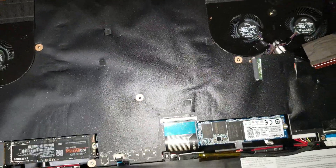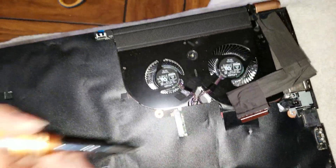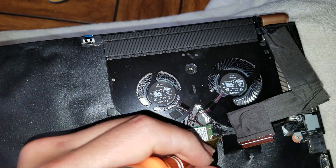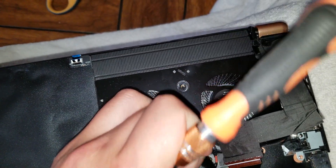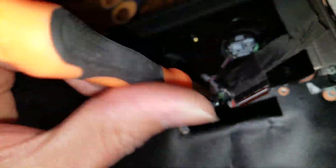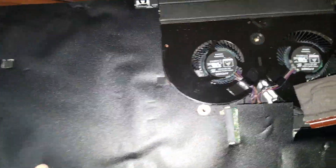There's also the wireless card — remove that screw. To remove the antenna connectors, pull from the back of the antenna, not from the front. Pull as close to the back as possible and it should pop up. Grab the wire and it'll pop up. Same thing with the other one — go as close to it as you can and just pull it up.